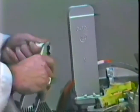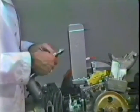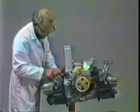Anyhow, almost all Bosch plugs used to come with the cap already on, which you have to take off to use the spark plug wires Porsche uses. The new plugs now come with the cap separate, and that saves you a few seconds. You don't have to take the cap off. I like to feed the plug in by hand. That way you avoid any possibility of cross-threading the thing. And believe me, a cross-threaded spark plug is something you don't want to have happen.